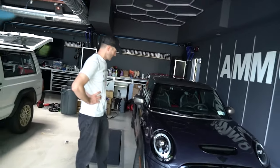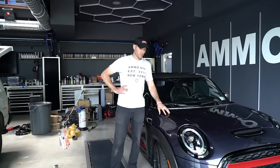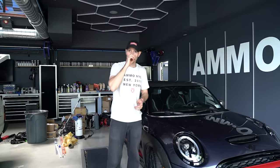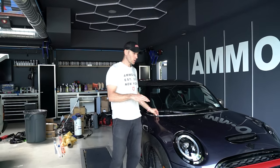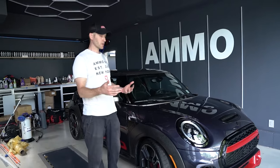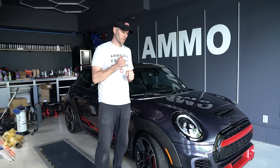So what should the care be for this installation — how do I keep it looking clean and lasting as long as possible? The first thing I always say is: I like to let the film have all the issues it's going to have before the customer shows up. We were playing with it because it had filled up a bit — totally normal — and I try to leave the car here for a day or two to find 90% of those issues. Once you have the car, I typically like a day or so without power washing, because you don't want to disturb anything that's just starting to dry.